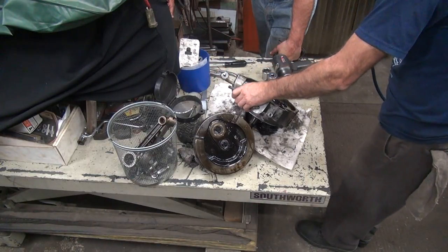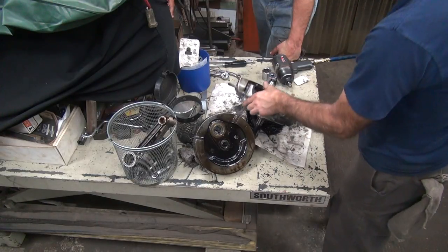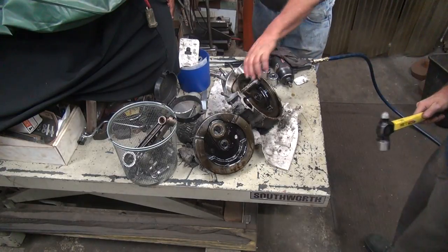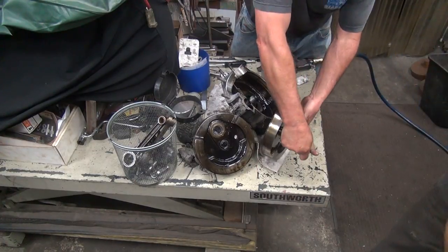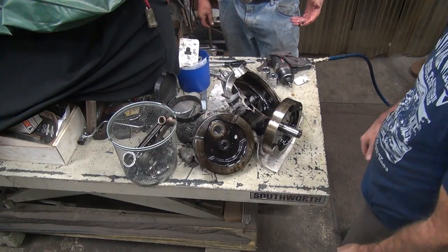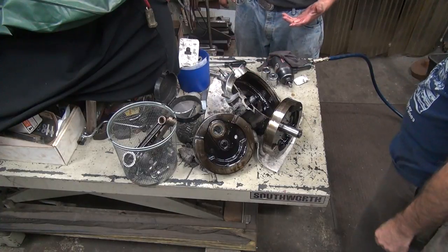Is this going to come off? No. Now, if you beat it like this, it just jams a thing in the table over there. So get a hold of it a little bit. That's why I use a big hammer and steel. You want the shock to pop the taper. Hitting with lead isn't as good as steel. Big hammer! Okay, now you can pull the nut off that one.